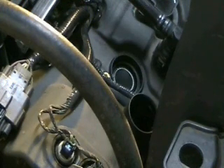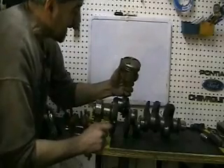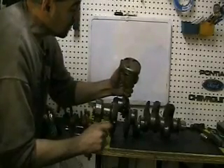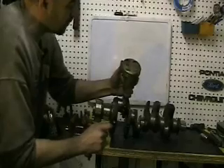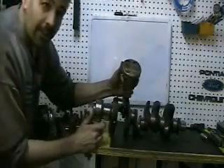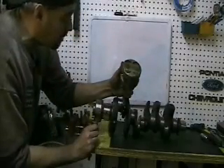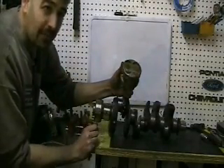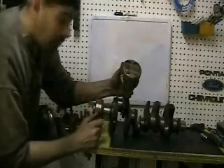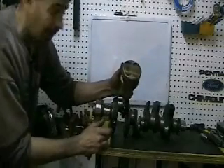I'll show you exactly what the mechanics are of what's happening in there right over at the bench. What we've got here is a crankshaft with one single piston on it, and you can see the piston moves just ever so snugly on the journal of this crankshaft. There are just thousandths of an inch of play that you really can't even feel — it just feels snug up to the journal so you can barely wiggle it.